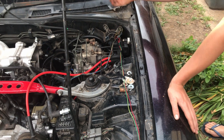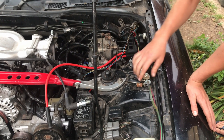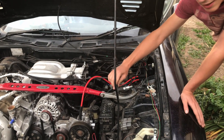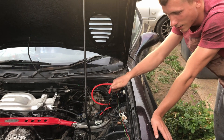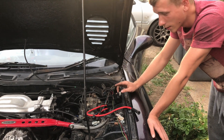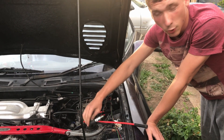The coils are mounted but it's not a proper install — I'm not going to change that because it just works. The wiring is a bit messy and I'll clean it up later. I've just hot-wired everything in for now. I want to do a comparison of the Yaris coils versus the IGN1A coils. My engine was flooded before on the Yaris coils and I couldn't start it, but when I connected the IGN1A coils it started straight away — so they definitely have a lot more power.